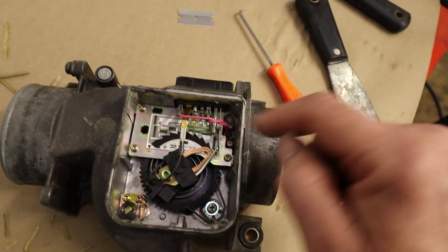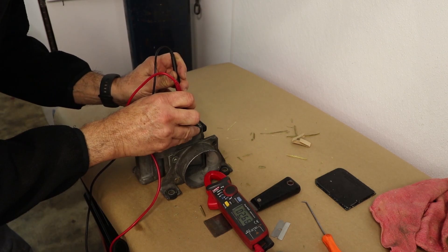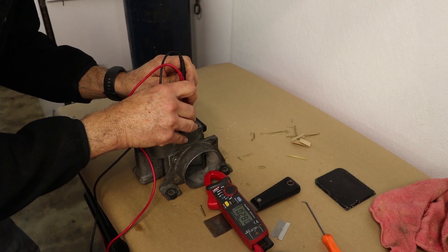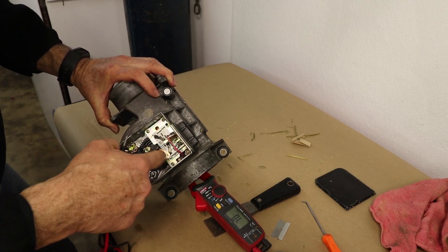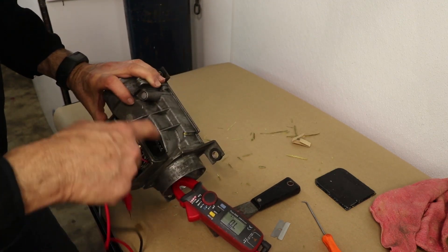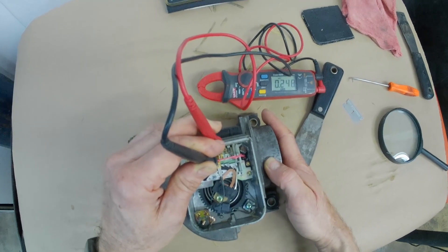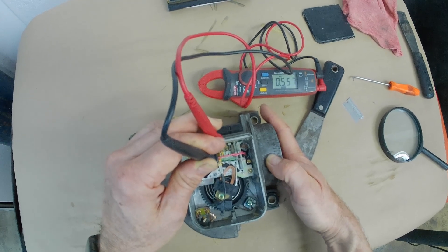Looks like these red wires go to the temperature sensor located right there on the intake. The temperature sensor is reading 2.66 kilo-ohms — seems reasonable. I believe these are the two outputs to the ECU, and this is reading 0.28 kilo-ohms. That's going from the black wire, which is the contact wiper, to the two pins exiting on this connector. Each segment gives a range of up and down values between 0.2 and 0.6 kilo-ohms, but one of these segments has an open circuit in it.